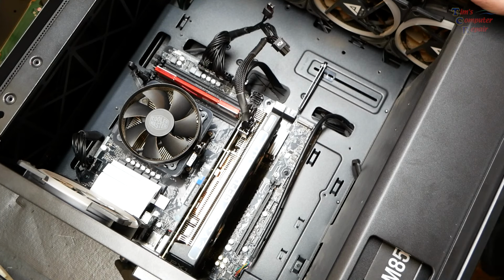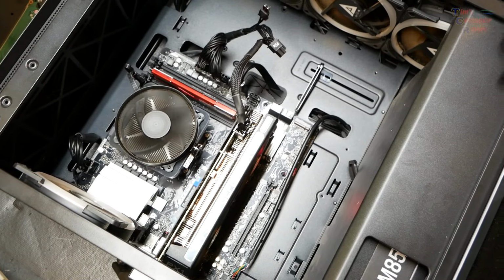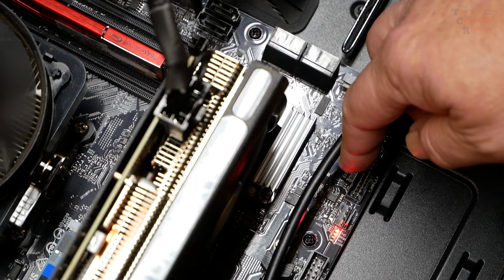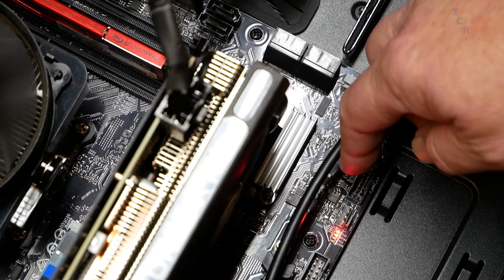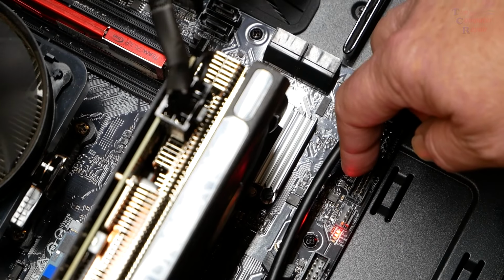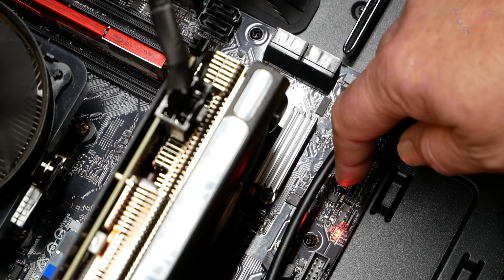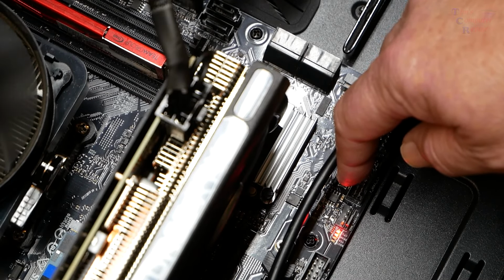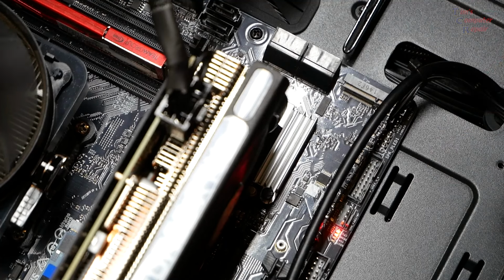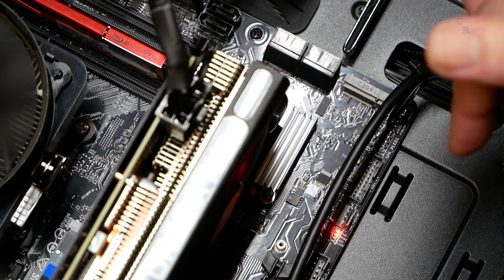I have my monitor plugged in there. I'll show you exactly what this does when I plug it in. Power it on. There we go. Of course, we get the fan spinning, but the only thing that happens here, see this light down here, 2 lights are constantly on no matter which way I flip around those RAM sticks. Those 2 lights are CPU and RAM, and every time I flip and flop the memory around, that never changed. That's never a good sign when you got the lights just coming on instantly like that and just sitting there.